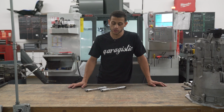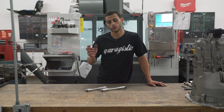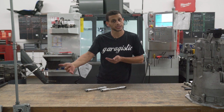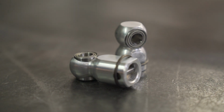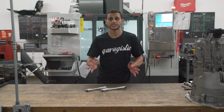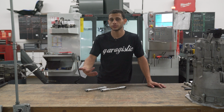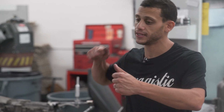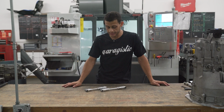These adjustable DSSRs offer precision shoulder bolts, which will actually fit into your shifter or your transmission side selector joint. If you're using our variation, there's a bearing in there, so that makes it very, very incredibly precise and tight for no side-to-side play. And on top of that, unlike the factory shifter assembly, you don't have to try to put a pin in and try to push another clip on there. So you just need one tool and you'll be able to tighten those things.